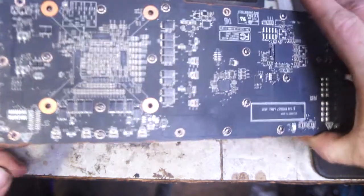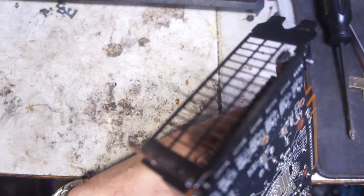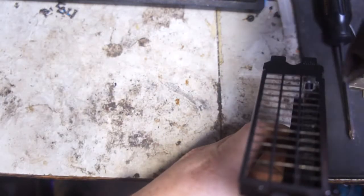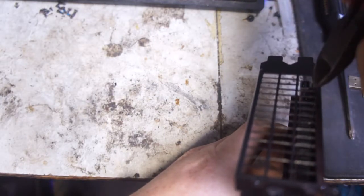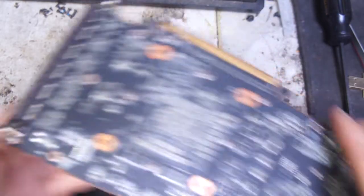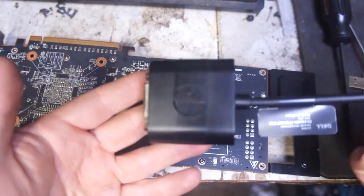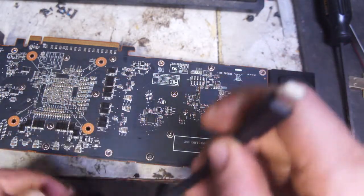One other thing to point out: your mini DisplayPort is towards the bottom of the bracket. See these little cross-section pieces here? You need to cut out two of them that are covering that port. Use some side cutters — get in there, snip it off, try not to wrench on it to where you break the port. Then if you have a DisplayPort monitor, use a mini DisplayPort to DisplayPort cable.